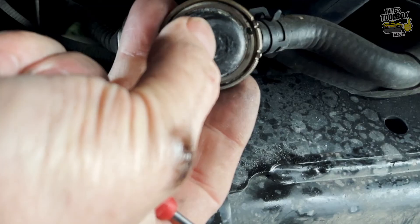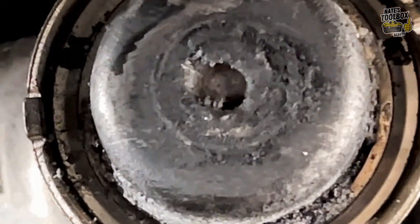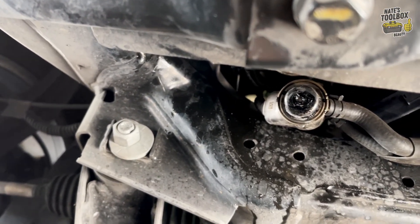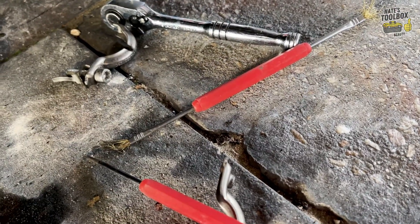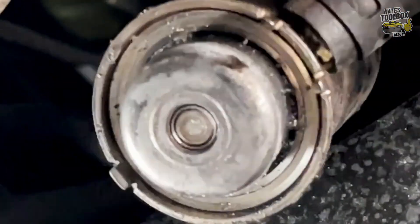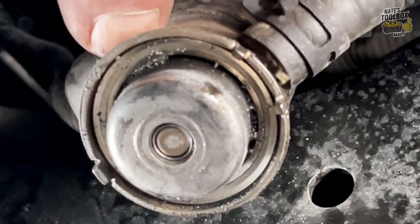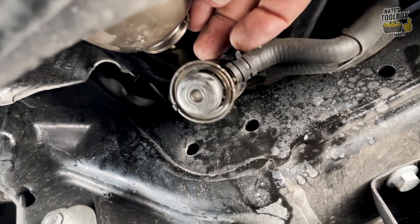We can now see some shiny metal inside the injector hole. I can see that small hole there — let me zoom in. We can now see the injector clearly. I'm going to give this a bit more of a clean with the brass brush. I've attacked it more with the pick and it's come up way better — there was more crud around the injection port than I thought. That's how it's supposed to look. We can clearly see the injector port in the center, that small tiny hole right there. That's how your AdBlue injector should look — pretty clean now.